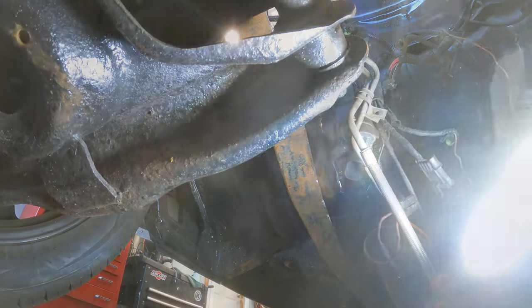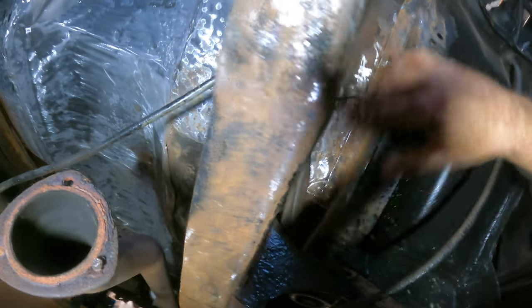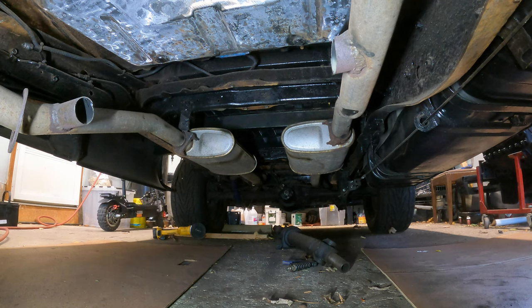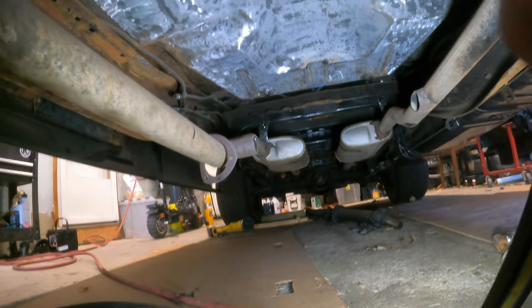Oh holy — wow. I'm getting there. I got this all pickled up in here and cleaned off. I'll get some paint on that. I've got to go back there where the hanger bearing was for the two-piece driveshaft, because we're going to go with a single-piece driveshaft now. I've got the crossmember out, as you can see. Whether we build one, buy one, or put the other one back in, I don't know. We're going to have to get the engine and transmission in the truck first and then see what we need to do from there.